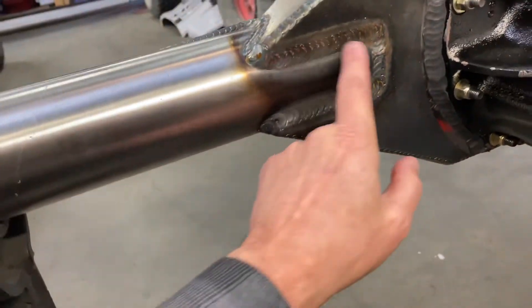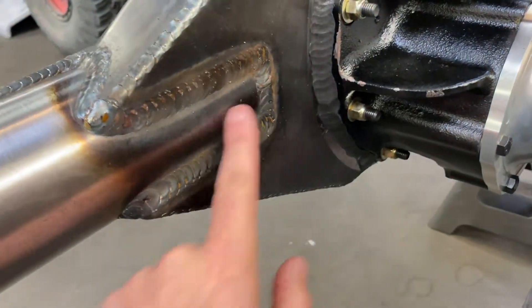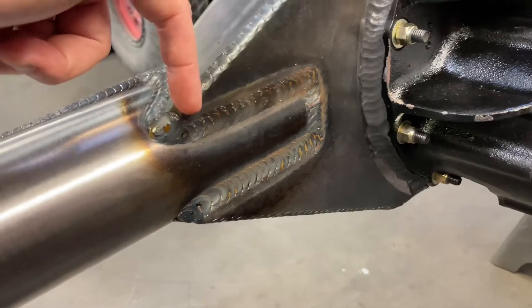As you see, there's a lot of engagement here. You can also see the weld marks here and the plate inside that caps off the end of the tube. So there's no oil getting in here — keeps all the oil in the middle by the diff.